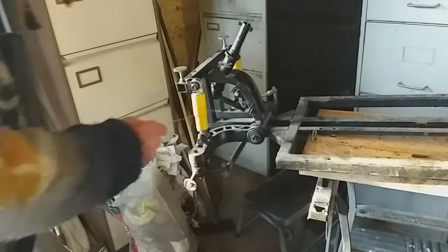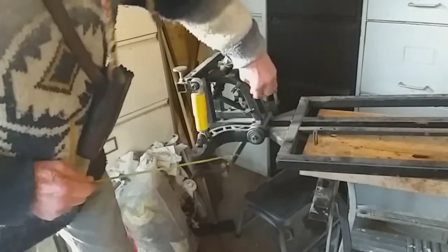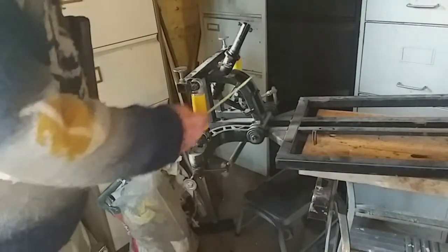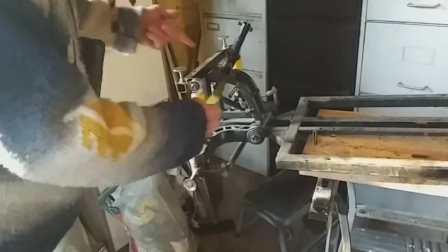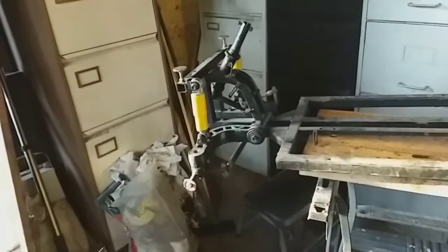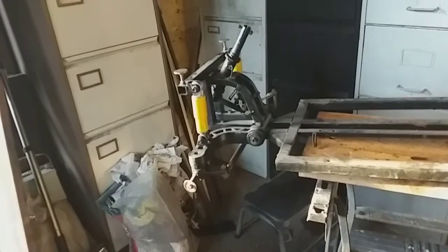Also what I've done on the chassis is I've cut all these bits of metal off because I find they're a bit of a bloody nuisance, and it's easier to just use cable ties wherever you want. So I've just cut them off and then got a flap disc, just sanding them around flat before I've painted it - which is an added thing to do.